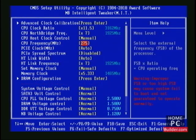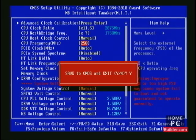The system probably won't boot with the reference clock set to 275. 250 MHz is more realistic — just about every motherboard can handle 250 MHz, so it's safe. I'll hit F10 and say yes to save and exit.